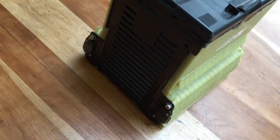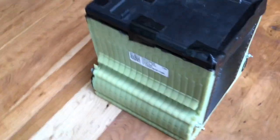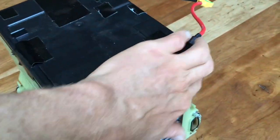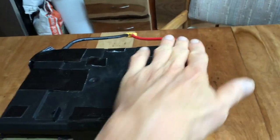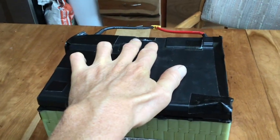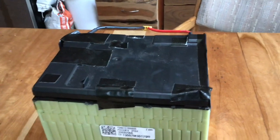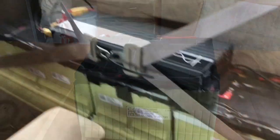There are steel plates on the ends — I left them in where I could. Where the steel plate was missing, I just used some washers instead. You'll get eight of these 44-volt packs, plus two 22-volt packs that you can combine together with a bus bar, positive to negative, to make one 44-volt pack. Then tie that in parallel with all the other 44-volt modules. That's what I did.